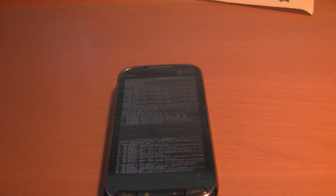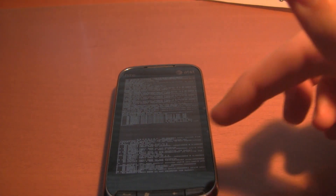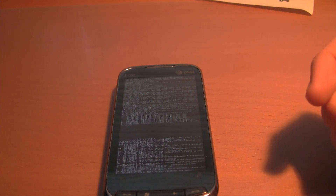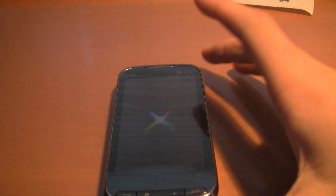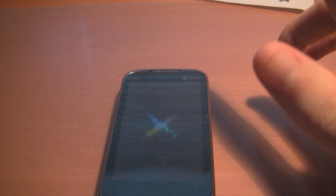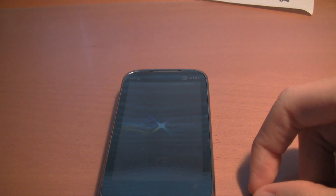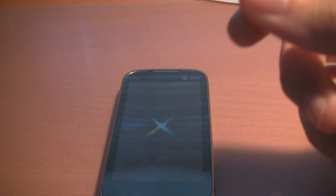In this version I'm running right now: obviously the LCD works, the digitizer — meaning the touchscreen — works, the QWERTY keyboard works, the front keys work while they do not illuminate. You can see the Nexus One logo as it's booting. The volume keys work, the stylus sensor works, and because the accelerometer doesn't work in the phone, they programmed it so that when you pull your stylus out it will rotate the display.